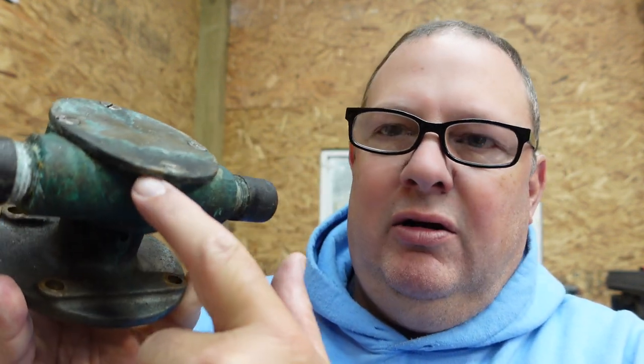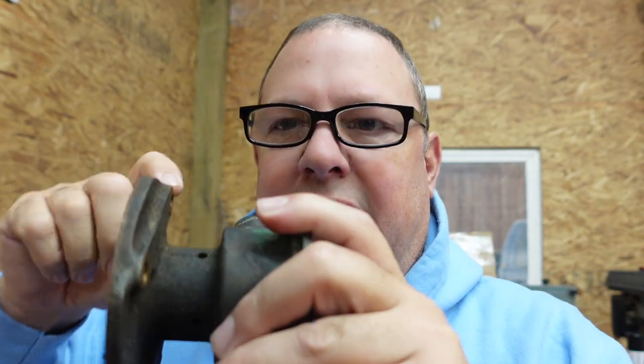Now that I've got my pump off my engine, we're going to look for a couple different things. Right here, around this area, to see if this front cover is leaking or not — mine was not. Next thing we're going to look at is water leaking from these holes — mine wasn't leaking there. Next thing we're going to look at is these weep holes. There are several around this pump. Mine was leaking. So in this case, I need to figure out why. If you have water coming out any of these holes or this front cover, you've got a failure and you need to do some repairs.